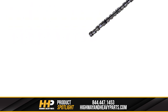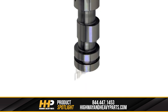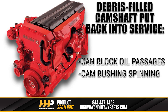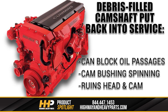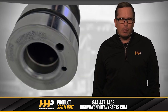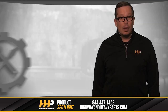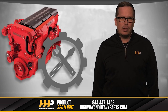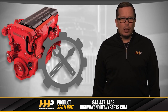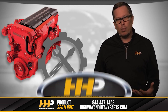When the cam is removed for repairs and a lot of times it's set on end, even a small impact can cause some of the material to break loose inside. When it's put back into the engine, it can block oil passages which results in a cam bushing spinning, which ruins the head and the cam. To prevent this, a soft plug on this particular cam needs to be removed. The inside of the camshaft should be cleaned and then the plug should be replaced. Cummins has a service parts topic out on the installation of these camshafts which we recommend taking a look at. It's important to note the proper way to clean these camshafts and that you might need special tools like a timing wedge to help fine-tune the engine to run more efficiently.